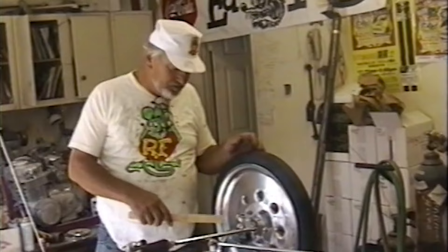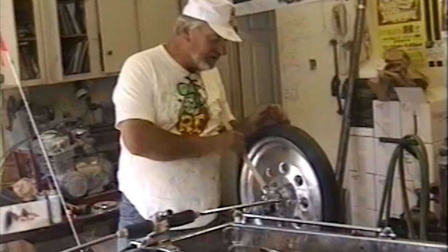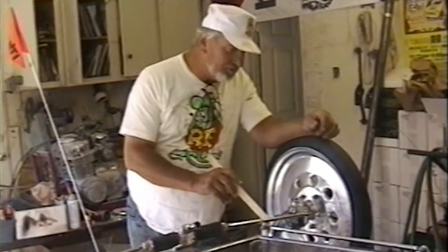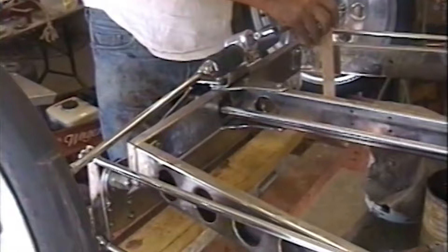I made the axle out of plate. I took forged spindles and ground off everything I didn't need and remounted the actual spindle itself to be in a little further. I put plenty of caster into the front so that it would handle well at high speeds. And I put a four-bar on it because I still think that these hinge-jointed four-bars are the best looking and also the best working. I got it low to the ground because a lot of guys build rods and they don't get them low to the ground. My frame rails are only four inches off the ground — I learned that from building motorcycle three-wheelers. You want to stay low so that your center of gravity stays low.